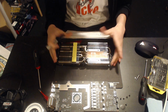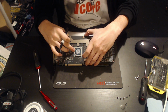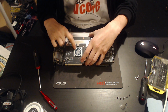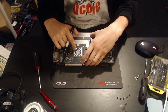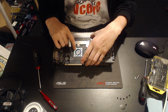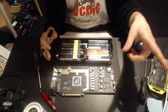And I think that's mostly because this GPU core that I got pulls a lot more power than my GTR does. And I think that's just random luck of the sample. This is a crappy RX 480 sample. It doesn't overclock very well. It runs pretty hot. It does come with a really low stock voltage of 1.075 volts, but it still runs really hot. So I guess it's leaky as hell. And it reads a really high power draw rating in GPU-Z.